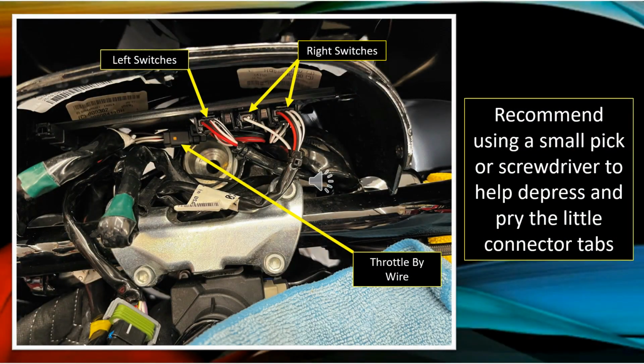So you can see what I'm about to do, I made this little drawing because it's much clearer. As you can see, the left side switches have one plug on them. The right side switches have two plugs on them. And the right side also has the throttle by wire, obviously. So I highly recommend using a little small pick or a little small screwdriver to depress those little tabs and help you pry those things out without damaging anything. Anyway, that's what I'm about to show you in the next video clip.